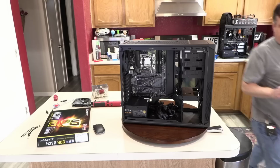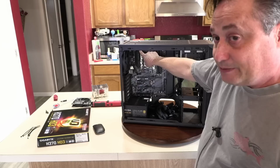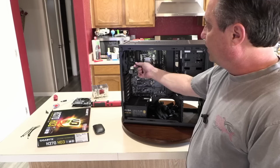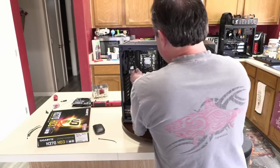Now there's two things on this motherboard that I'm going to have very difficult access to get a hold of once that heatsink's in place. For this motherboard, it's that 8-pin connector I have already talked about right up in this corner. And then next to it is a case fan header. So if I can hook this up right now. So the first thing I want to do is go ahead and zip tie this cable, because again, that will also be very difficult to try and cable manage after the fact. Once the heatsink's in place, it'll block access to it. I can pretty much keep it the way Corsair's got it here.